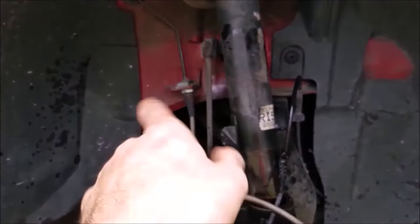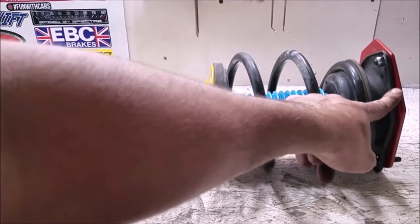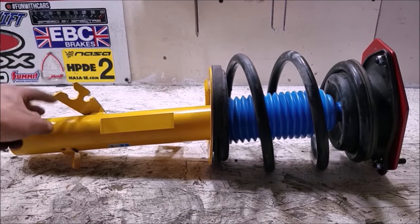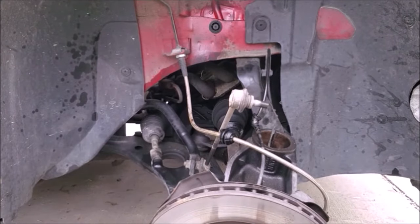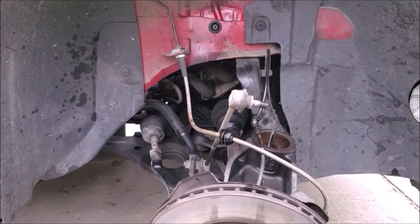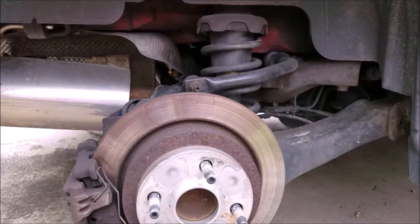Once everything's out, go up top, unbolt everything, and it'll slip right out. Take it to the bench, put the spring on the new strut, slide the new Bilstein strut back in, and we can go take it for a test drive. With the fully assembled strut — new Bilstein strut, camber plate mounted to the top hat — we'll slide this back in the car. Install is just the reverse: put it in at the top first, then line up the knuckle and slowly raise it with a jack to slip it over the bottom of the strut. Clean out the inside of the knuckle with a scotch-brite pad or steel wool to make sure everything fits well.